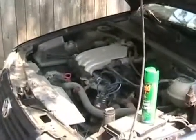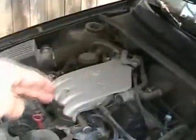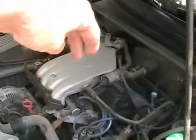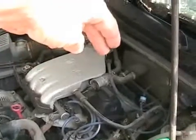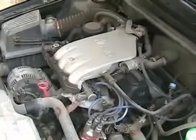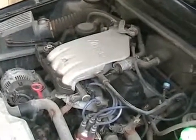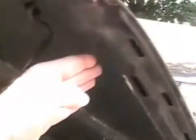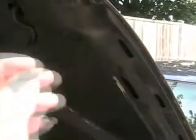In the higher revs it has what's called the ram air effect. Air moving in has velocity to it. It means it's traveling, it's dynamic. So the faster you are revving your engine, or the RPMs are, the faster the air is rushing in. Well, since something that has velocity and mass also has kinetic energy, which means the energy of motion, that means if you have a mass of air and it's flying along and it hits something, it compresses against it and builds up against it in a little pressure wave.